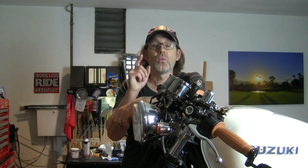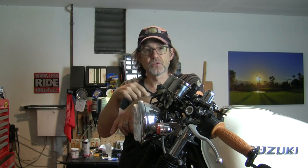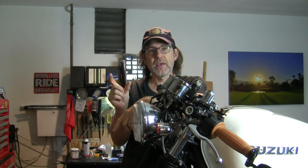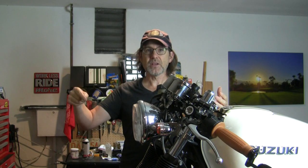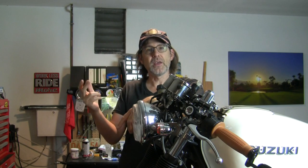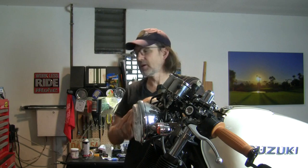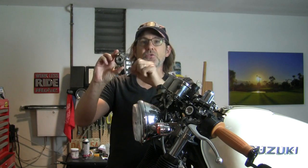When I had taken my old cable, the original stock cable from this bike, apart and cut the inner and outer portions, you got the outer shroud and the inner cable itself, I measured that free play on both ends from the stock before I made any cuts, but in the process of putting that ferrule onto the cable more than once because it kept popping off, I ended up shortening that cable to a point where I believe the overall length of my inner cable was getting in the way of my clutch functioning properly because of where it was contacting the actuator.